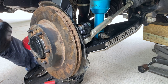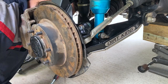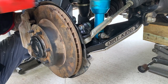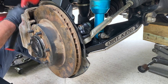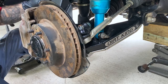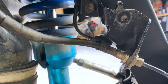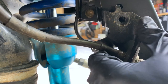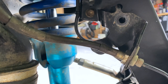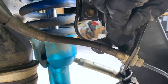Moving along getting the calipers in. There's a specific tool to move the brake pads but I don't have that — I just use a regular wood clamp. Just make sure they're nice and tight. Now what I'm going to do is get this bracket onto this spot here. If you look, the gussets kind of stick out a little bit more than the stock ones.